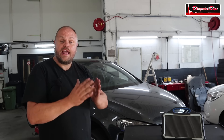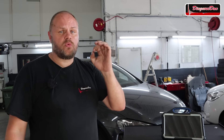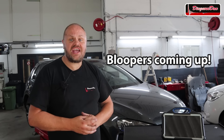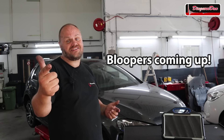I'm going to return the car to the customer, who is a mechanic and will replace the resolver himself. It isn't an easy job — it involves pulling the transmission and splitting the transmission case from the drive motor, just like we had on the workbench. The information in this video doesn't just apply to Volkswagen; most hybrid and electric vehicles have a resolver that works in exactly the same way. I really hope you enjoyed this video — if you did, please subscribe to my channel and hit the bell for notifications. Remember: Diagnose Dan, fix it again — see you next time.